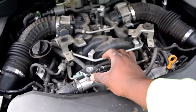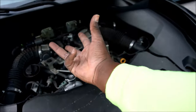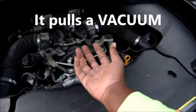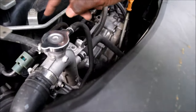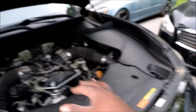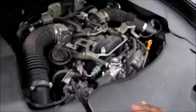But what's supposed to happen is this: the cap is an airtight seal, so that when your engine cools down and the water starts contracting, it pulls from the reservoir side — and whenever you have excess coolant here and a good radiator cap, it's supposed to pull it backwards into your system. So that's what's not happening. It's either the pressure seal is good but the airtight seal is bad, or the spring is just bad in itself.